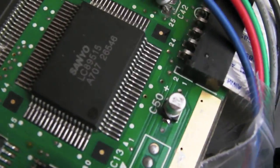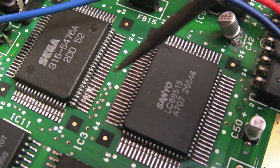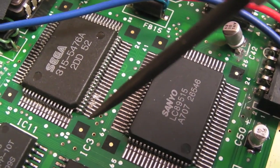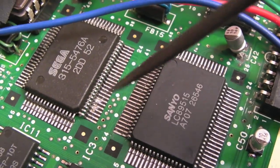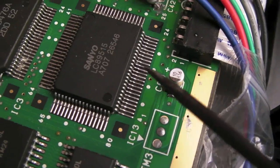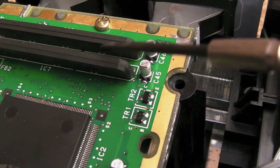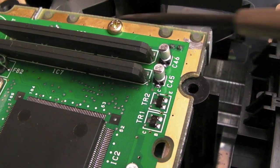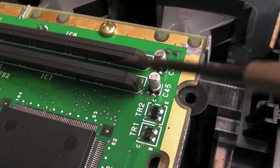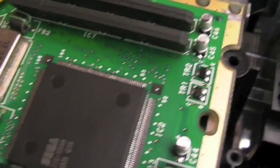Another quick progress update — third from last, solder joints looking pretty good. I'll tackle that awful-looking one next, then there are just three more. You can see some contamination between some pins here — I'll gently brush that area with IPA; it's just dirt, not corrosion. You do have to watch for corrosion from leaking caps though. One of the most risky areas is over here where you've got the DRAM or SRAM — the electrolyte can eat around the connections, and it's very difficult to clean because of that ZIP-type package with its zigzag interlaced pins.